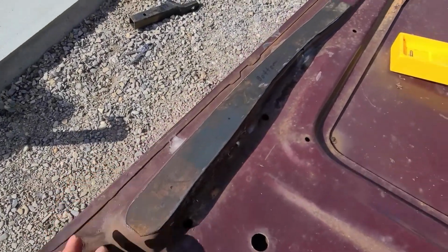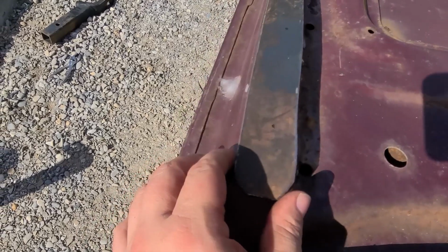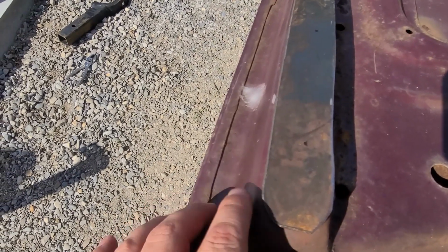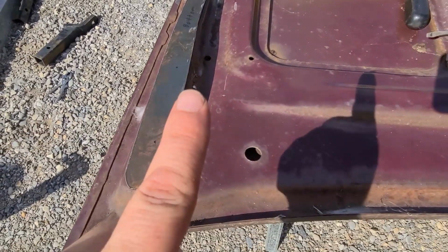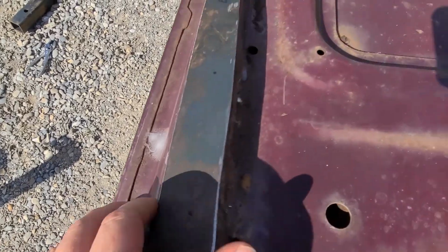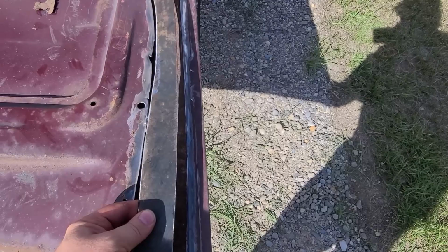And there's the top rail, perfectly aligned. Now this edge is just a little bit proud here, because when I bring these together, I'm going to make it so that this corner is the hollow corner that I'm going to fill. So I'll fill both sides with weld so that I can feather it and grind it over smooth to try to replicate this rounded edge. So this just goes over here, turns over, and is going to butt in right around there.